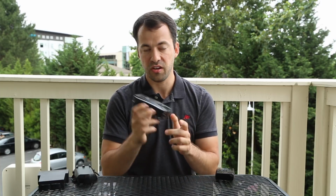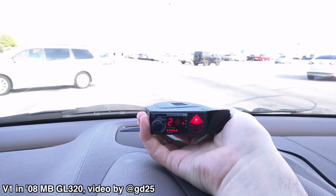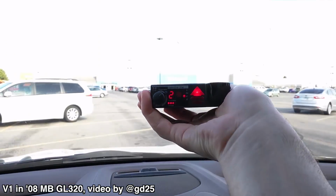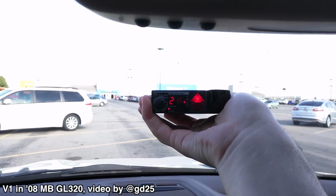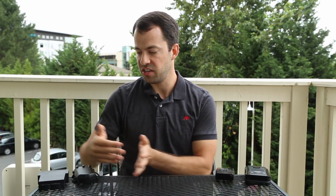If you're parked near an automatic door opener and you're taking a look at the signal strength here, you can move it back and forth and see if that affects anything. Certain vehicles that actually have a windshield like this, they may have a little cutout in the windshield where you can install a GPS receiver that also has wireless communication going through the windshield, a cell phone, a toll pass, or a radar detector. Some windshields have special cutouts specifically for this, but if you have other things in your car like a toll pass or a GPS receiver, you may not necessarily have room for this. And so if that's the case, out of necessity, you're going to have to go for a custom install detector.